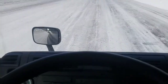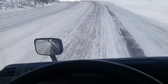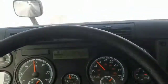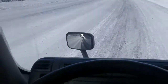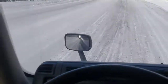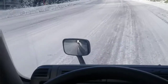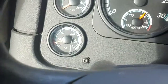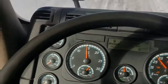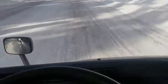Now just this downgrade here — we're going to start feathering the brake and I'm going to stay in ninth. I've got my foot over the brake, we'll keep it right about 1,400 RPM. You can see how we're building up some air — I want to keep it just a hair under 20 pounds. I'm feathering it for a few seconds and then letting off.